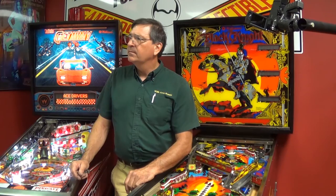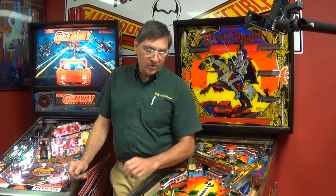Who did you find to be the worst manufacturer? The ones you couldn't adjust. Well, you can't do anything with plastic - it's got to be this style of in-lane where it's metal. Plastic guides like on a Stern? Yeah, there's nothing you can do with them. The Data East machines sit down in a little hole - there's nothing you can do there. If you really truly had a problem, you could remove the flipper assemblies and relocate the plate, elongate the holes in the flipper plate to get your 32nd of an inch of play - move the flipper towards you. You'd have to do eight holes. I've done that before, because the flipper shaft through the playfield is plenty big enough. I recommend trying this method first.